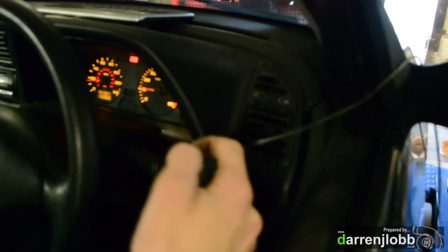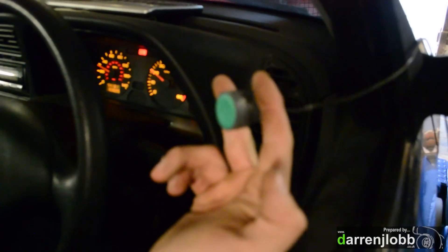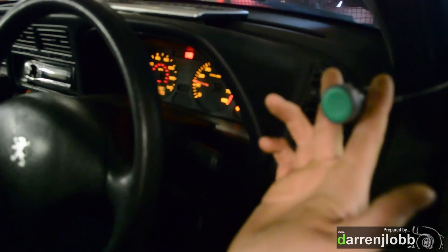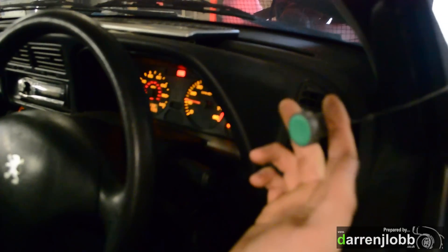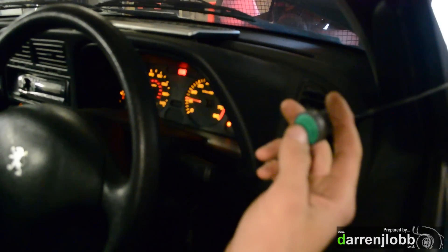It's pretty simple to operate this one. I've got this button in my hand here. I've got my foot down at the moment — it's just inertia running, doing nothing. If I push the button it'll load the car back. I've got my foot to the floor now, so I've pulled it to the 1200 RPM starting speed which is what I've set. When I push the button it'll start pulling in 300 RPM per second, which is what I've set.